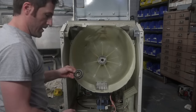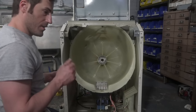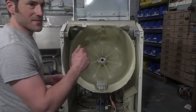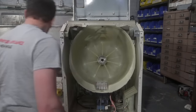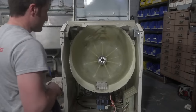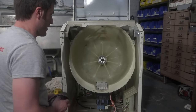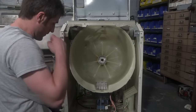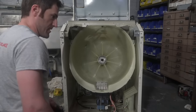So you know you're in when you're tapping with your hammer and the sound drastically changes. It goes from a low pitch to an extremely high pitch. You'll know that you hit the end because it feels different when you're tapping on it. It feels like you're hitting against something extremely solid. And that's when you know you're in good shape. Well, when just watching it, it looks as though you're hitting the outer ring as well as the bearing, and that's why the sound changes. Oh, no, no, it was still sticking out for that. It was? Yeah. Okay. Now, when the bearing sets in the back, like there's a seat for it, that's when it's seated all the way. It just makes a weird noise that you can't mistake.